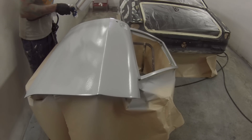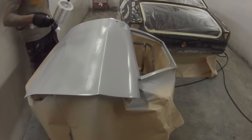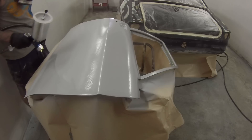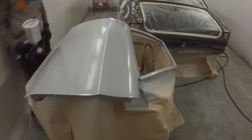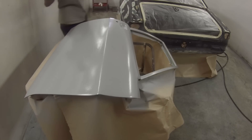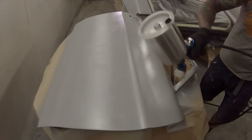I haven't by any means written this gun off yet — I'm yet to use it for base coat and clear coat. HVLP spray guns: don't forget, unless you've got a high CFM compressor, you will struggle to run this gun at a consistent pressure because they do require a high volume of air to keep them running, because of the size of those holes. You can see it is getting the primer on there, I just like to get it on a little bit quicker.